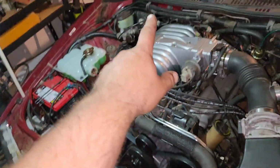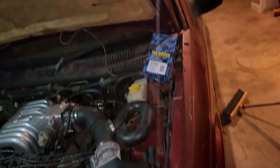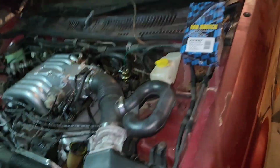Alright, so like I said, I'll have this edited and uploaded tonight. It's, I don't even know, 8 o'clock or something. But yeah, should have been a lot further along, but had like 4 days of stuff around, waiting for these parts that never arrived. Which puts me to the point, I still haven't done the fine tune by bridging the pins on the diagnostic plug. I know how to do it. And I still got to wire up the thermofan switch. This is the Davies Craig one. Got the same one in the XD. Good, no problems. So, pretty happy.